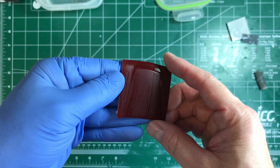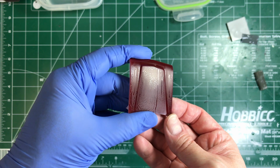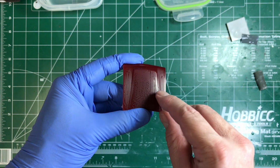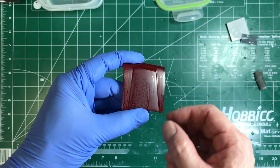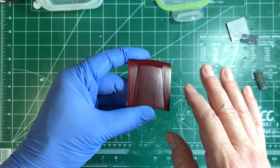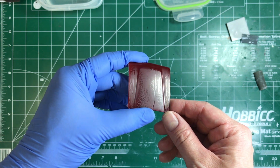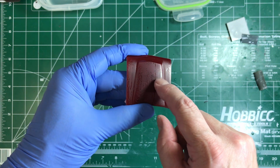Alright, so the clear I used was the Zero Paints 2K clear, and it went on really thick, which gave me some pretty significant orange peel, as you can see there. But again, in this video, I'm not really worried about that. I'm worried about the ghosting, where it sinks into the putty or the filler or whatever. Whenever you paint over the top of it, it reactivates it, soaks in. Put clear coat over the paint, reacts everything again, soaks in some more. So it just kind of keeps sinking over and over again. And that's not what we want. So again, protected with UVLS clear by Createx, not protected.